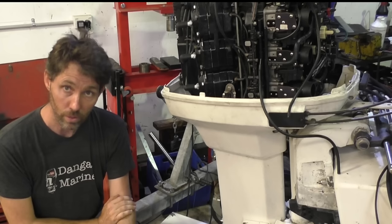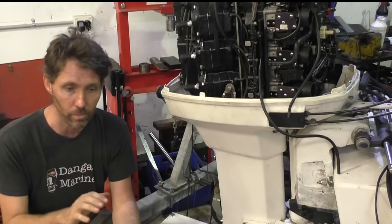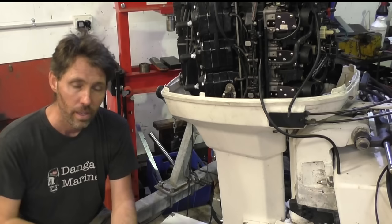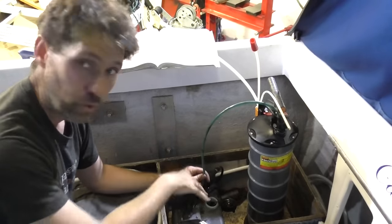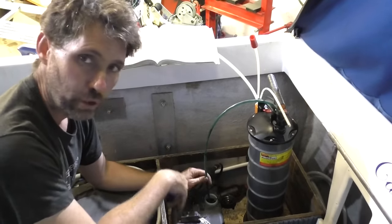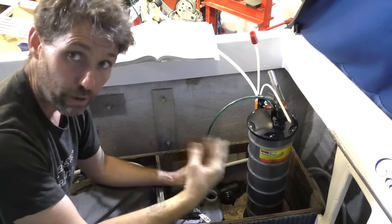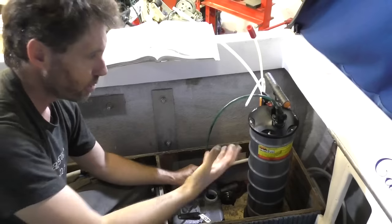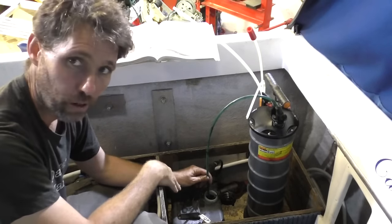What I am going to do is drain the VRO oil tank, just in case there was any sort of water or anything at the bottom of that. So we'll put brand new oil in, then we'll use the prime bulb to push all the old oil out of the oil line so we get clean oil all the way through. Then we'll also add oil to the fuel tank, so we're running pre-mix as well as leaving the VRO active. I'm going to use this vacuum pump to draw the oil out of the reservoir, and once we've got new oil in I'll prime a bit into a container to push all the old oil out from the line. These vacuum pumps just need a few pumps to store vacuum and they'll keep sucking, so you don't have to pump the whole time. We'll let that drain and then put a whole lot of new oil in.